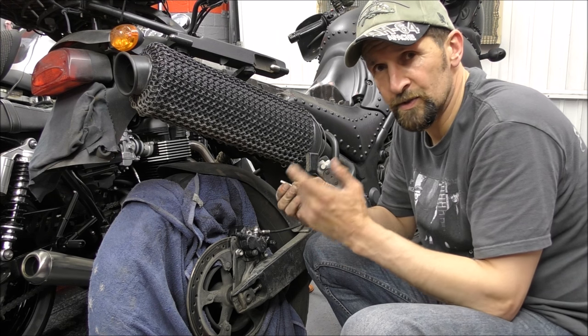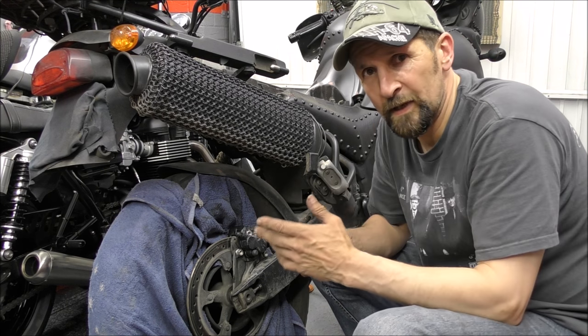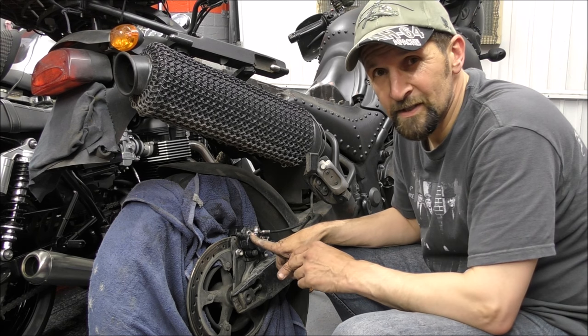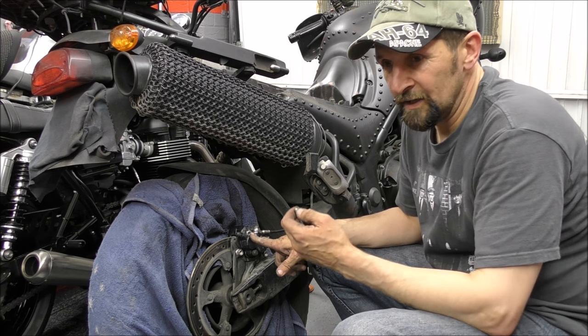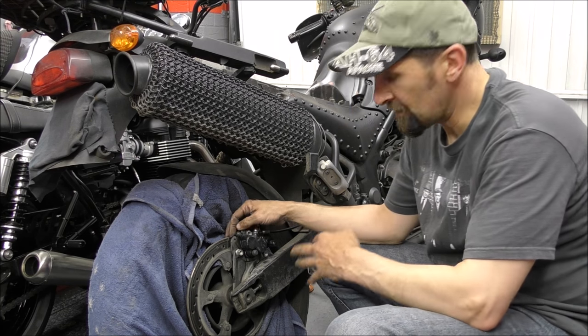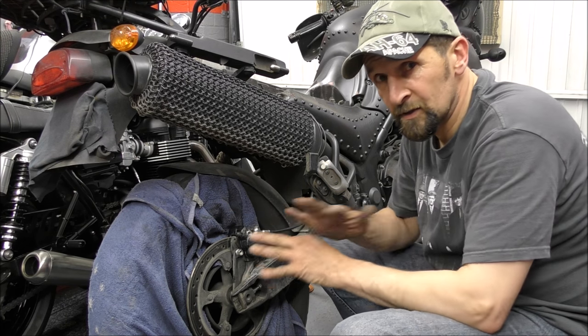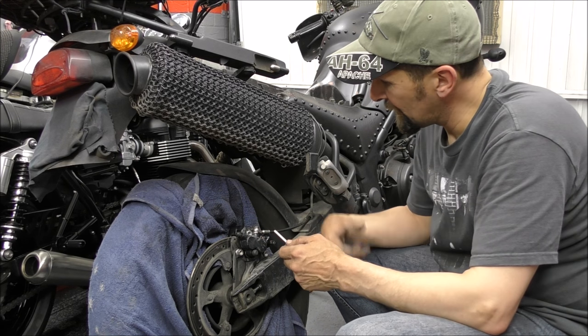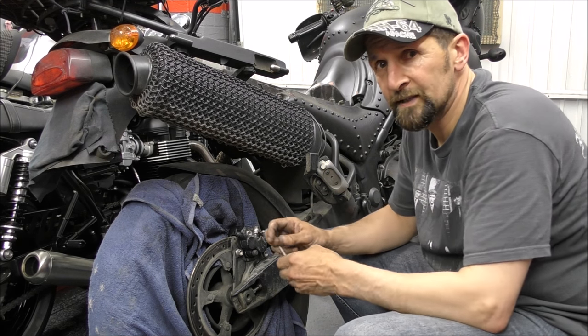Don't use autos, don't use WD-40, don't use oil or grease or anything like that, because in this environment, it's gonna go all over the brakes, it's gonna trash your pads anyway. So if you really wanna put new pads in, you can. These are virtually new. I did a video on fitting these a while ago, and they're absolutely fine. So I'm gonna go off camera, I'm gonna call it a day. I'm gonna take that apart now, pull it off. Pull the other one out, take the pads out, clean them all up, put it all back together with these